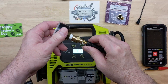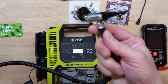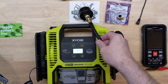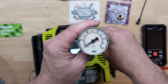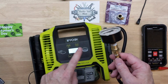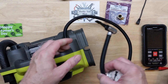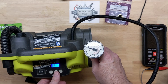One thing I don't like about this model is the way the end is on the hose — this is the older version. The way it just clamps on instead of screws on; I just prefer the screw-on style. We're not even building up to maybe five or six PSI on the gauge, and it's not showing much on the digital display either, which I don't think is the whole problem. I'm going to bring over my older P731 model and show how quickly it builds pressure with a closed system.